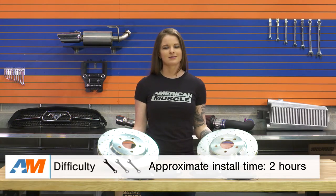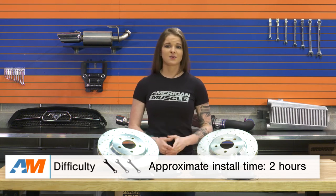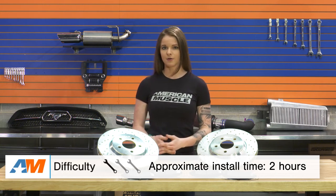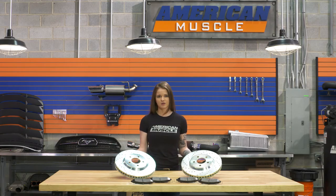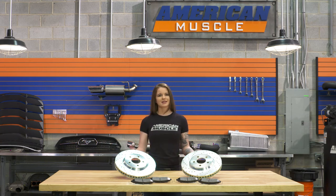When it comes to the install, it's not extremely time-consuming, but you are gonna want to have a little bit of knowledge in order to do this yourself, and that comes down to a safety thing. If you weren't sure, I'd side on letting a shop perform the install, but otherwise you're looking at a two-hour project and a one out of three wrenches on the scale. To give a general overview, you're looking at disassembling your front brakes — calipers and rotors come off — so you can swap in your new rotors and pads. It's nothing difficult, and you don't have to do anything you wouldn't normally do during a standard brake maintenance.